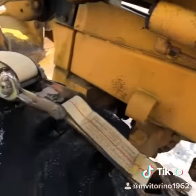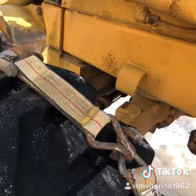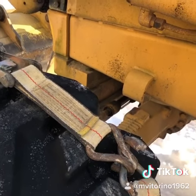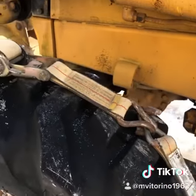What I do is I put this ratchet on the tire — a big one — tighten it down as much as you can. That brings the walls of the tire right up against the rim on the outside, and then go ahead and fill it up. That solves your problem, but it's a hassle doing it every weekend.